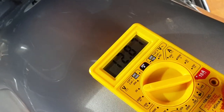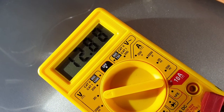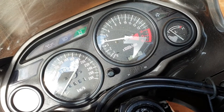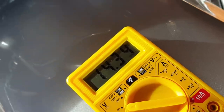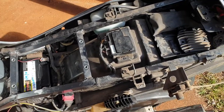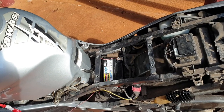I checked the starting voltage — it was holding. Then I revved it up to about 5000 RPM and it was still holding. I couldn't figure out what the problem was, because the battery was obviously being overcharged. If the regulator was faulty and you rev it to 5000, the voltage should go over 15 — but mine wasn't, so I couldn't figure it out.